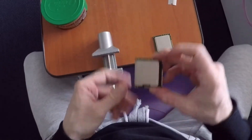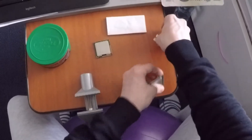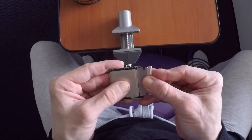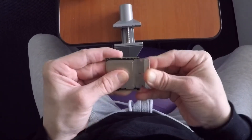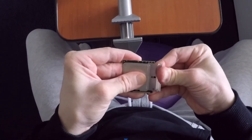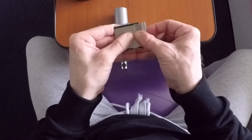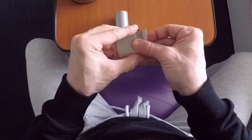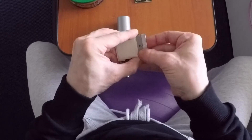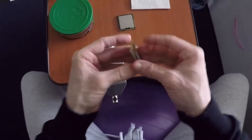As you can see, it is aligned with the die's side. Then you just grab your blade again on the right-hand side, because there are no capacitors nearby. Push the blade again to the same depth as before and try to lift it — it's not that hard. You're actually going to hear a click and it's going to pop off.